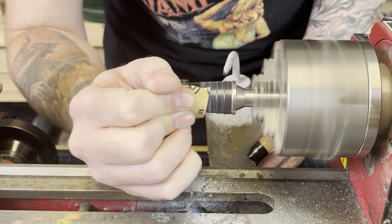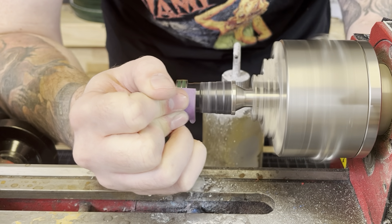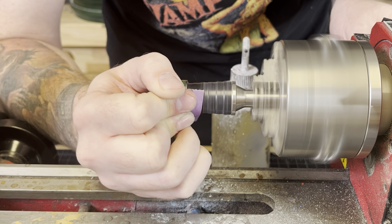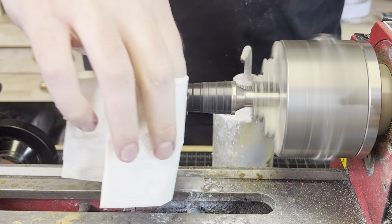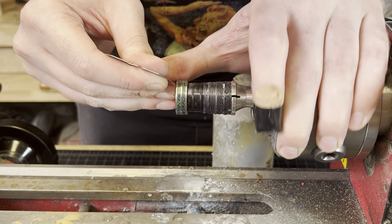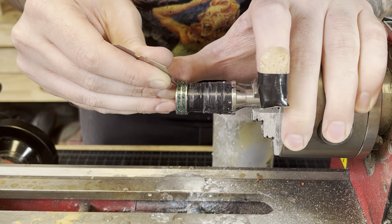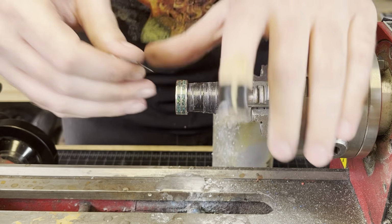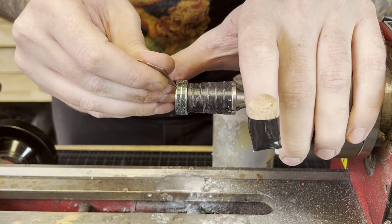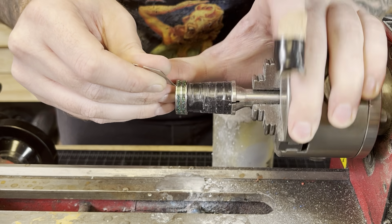To try and minimize how much time you spend working on those little hammered sections, you can wet sand a little bit extra with that 220 just to try and sand off any of those extra sections. But with these little divots being quite small, you'll more than likely need to go back in and clean those off. I like to do it after the 220, just so that if there is any small missing sections, usually the 500 grit and 1000 grit that I follow with after will clean it up.